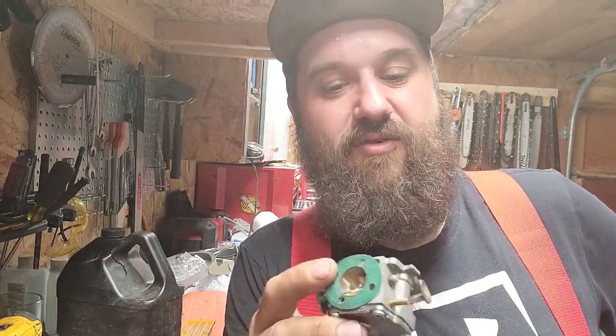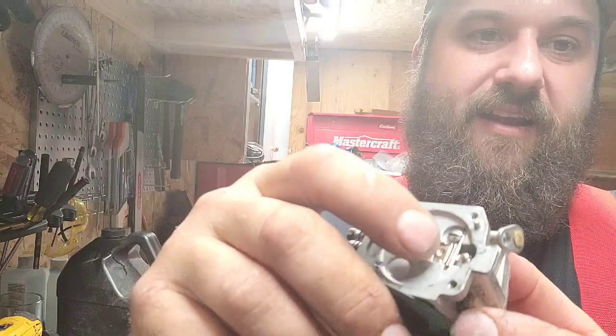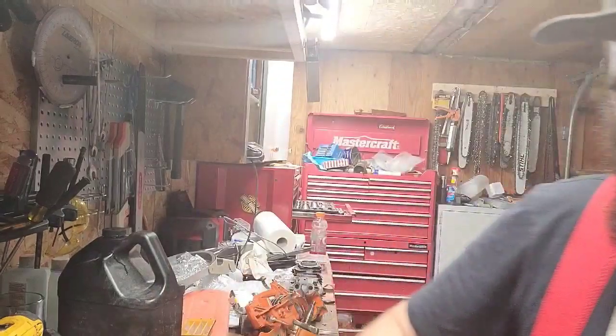I'm going to try and give it a little more fuel by raising the metering lever. Okay, it's going to open, it's going to physically, okay, it does that in these. There's no float, right? This diaphragm does that when the saw's running, okay? And that's why a lot of saws I get in here don't start. And guys are like, well, it started last time I used it. That's the standard thing. When was the last time you used it? Oh, like 3-4 years ago? Well, a lot of times the fuel, especially ethanol fuel, it hardens that. Now it doesn't move. So now your saw doesn't get any fuel. Or your saw will start and idle, but it's too lean on the top end. And the more you tune it, it doesn't get better. That's when you start looking at the metering or this diaphragm, okay?